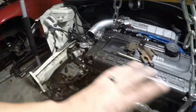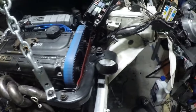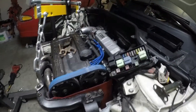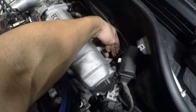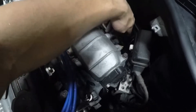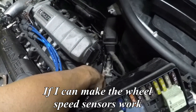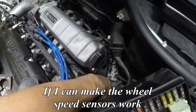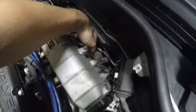The engine shouldn't move too much horizontally because we have two mounts set up left and right, and it shouldn't move too much forward and aft because we have two mounts for that as well — one here and one in the rear. We do have quite a bit of space in the back. The only thing we're going to have to move is the brake booster reference line, and the clutch line runs a little close so we'll bend it down and around. We should be able to use the ABS module and controller from the Mini Cooper — still have ABS — and the electric power steering back here clears just nicely.